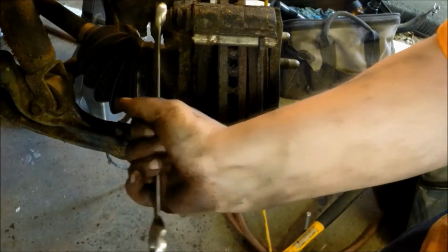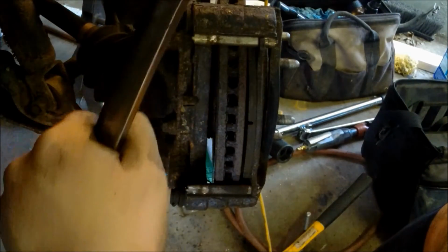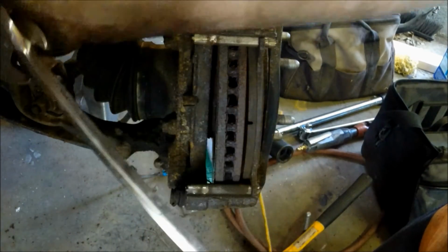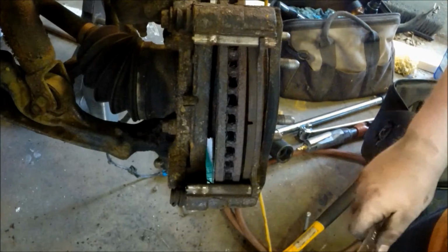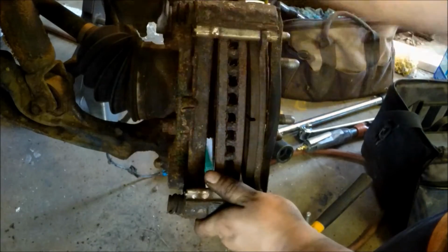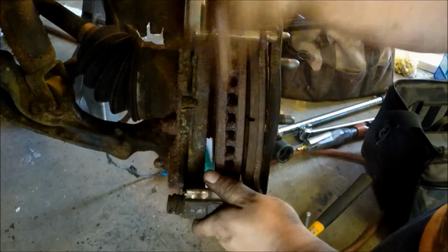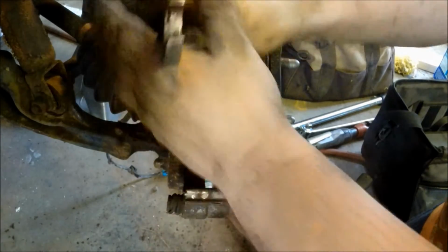Not a good view of it, but I kind of try to show how I can use two wrenches to get the leverage to remove these. Put the box end on the open end side of the wrench, and you double its length on whatever wrench you're using, increasing your leverage and making it able to take the bolt out with ease. Again, an 18mm ratchet wrench makes quick work of this.